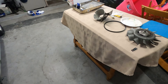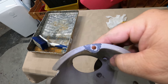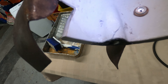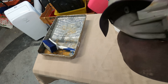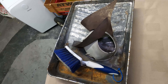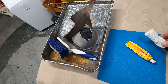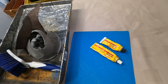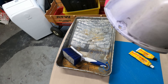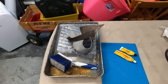Let me take you over to what I'm going to do with this. The air diverter gets beat up - you can see I've already JB welded it just to keep it from disintegrating. Plastics get brittle, rubber gets brittle - you can see it added a new crack. I'm going to throw it in here, clean it off, grab my sandpaper and rough it up, and use the epoxy to fix the crack and maybe shore up the other areas on both sides. I'll let you know what it looks like when it's all done.